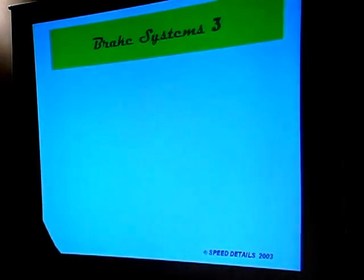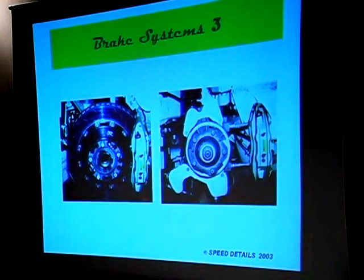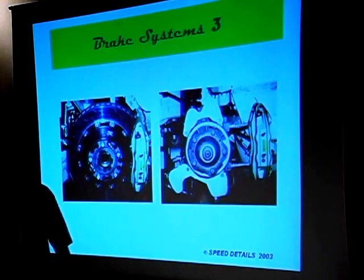One thing about this — the input for brakes isn't usually where the bleed valve is. It's usually somewhere in the center of the caliper, and there's usually a bleed valve at the top on both sides. There's also a crossover pipe around the bottom — another little detail you could put in. Brake calipers are actually attached to the hubs by something, and I have seen on a couple of occasions a caliper glued to a rotor where the only other attachment point is the hose, which doesn't work very well. So think about your attachment point.